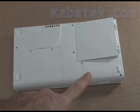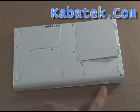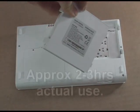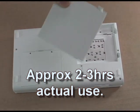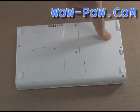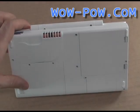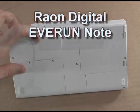Under here you have access to the mini PCI slot. You can put in a 3G or HSDPA access card, and then access that using your SIM card in here. Under here you have the battery — this is a 5200mAh battery at 3.7V, so you're looking at about 19Wh out of that battery. It slots in pretty easily; the back of the battery is the door, so it clicks in there. Over here we have some serious venting for the CPU — that dual-core CPU does get fairly hot, so it's got plenty of cooling to keep it going.